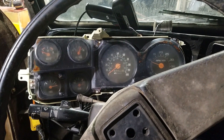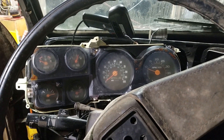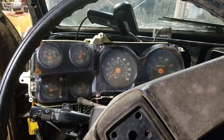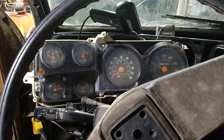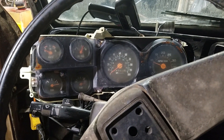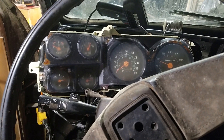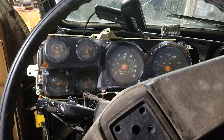I still don't have my front suspension totally done, so I'm not going to go down the road very far. But I'll take it on the road a little bit, let the engine get warmed up, and check the temperature, check the boost and the tach, make sure that's correct. I'll use an optical tach on the crank balancer just to be sure and make sure that matches up right. Otherwise I need to modify it a little bit. The fuel gauge — that's going to be a little while before that's actually up and running. We'll see if the speedometer works; I probably won't go very fast, but we'll see if it's accurate at all.